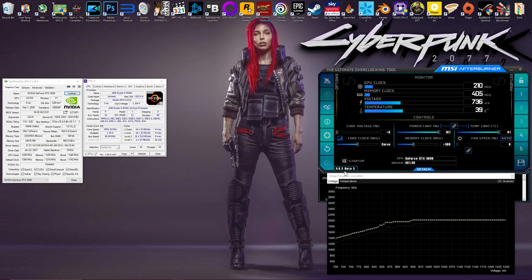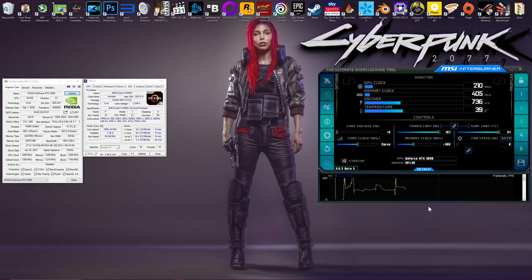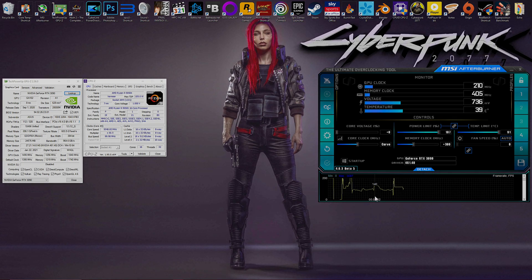This is how it's going to look when I'm actually running the overclock. I did nothing to the core voltage offset; I increased the power limit to my maximum of 107% and the temperature limit to the max. That's it. So without further ado, I'm going to run five or so games and you can see the difference between running your card at stock and running your card at overclock.